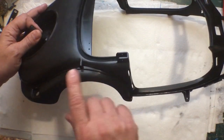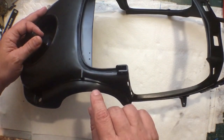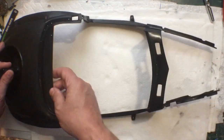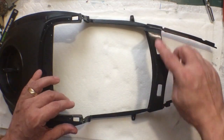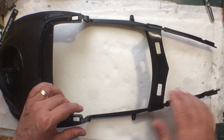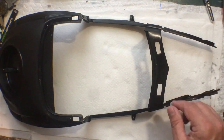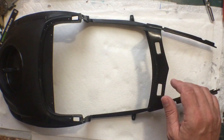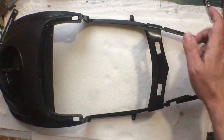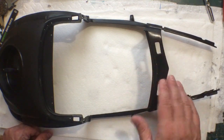It's kind of a bummer, it sucks, but at least you see it and you know you need to fix it. So I touched up this area once — that's already been wet sanded back down and that side is good. That little bit you see there is just a reflection, that's not the primer, so this side is all ready for clear. This top area here I had to redo a couple of times because as I was wet sanding it, it went through to the primer — right at the tip here. So I sprayed it again and I'm ready to wet sand this.